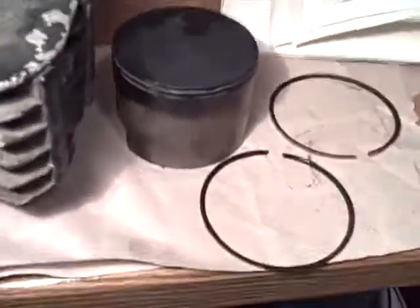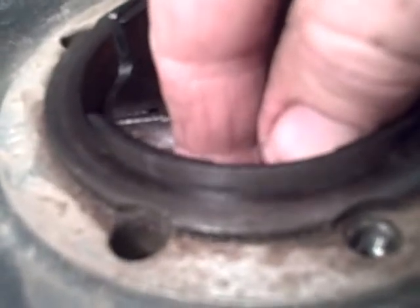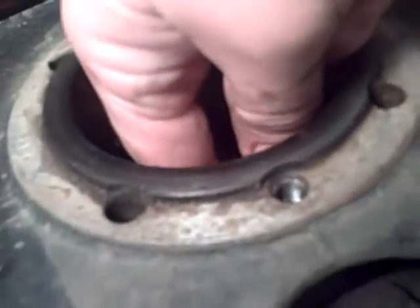I've got a lot of carbon — I have scraped this piston before, but it's due for it again. The cylinder looks like it's in near-perfect shape, but there's quite a bit of blow-by. That said, this is still a tight fit — there's no slop or anything in here.